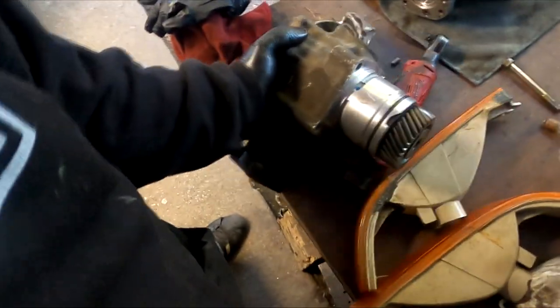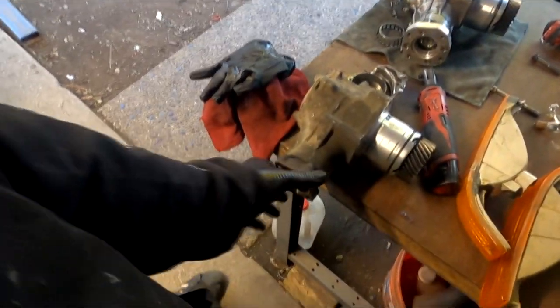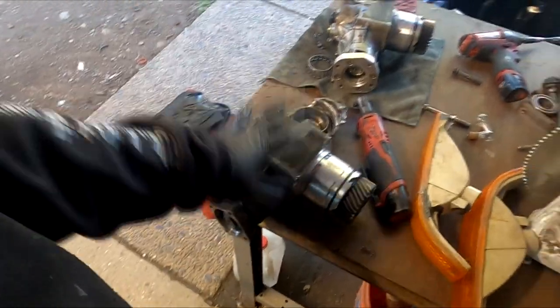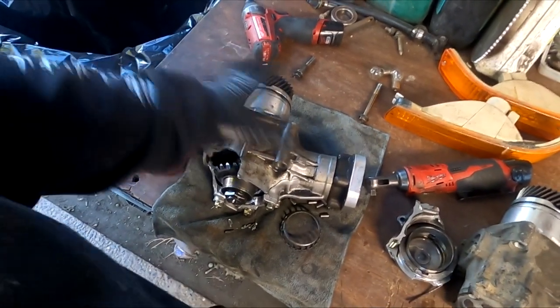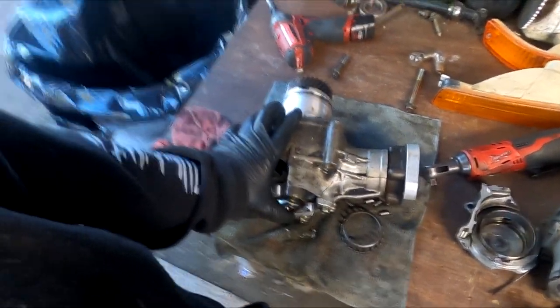The good thing is I have a spare transmission in storage and on my way back home I went and snagged it. I did have like three other transmissions but I sold them. So I'm going to transfer this transfer case over, clean the surface up, RTV it, reinstall it, and hopefully everything is good. If any of you guys have a B all-wheel drive five-speed transfer case for sale — specifically five-speed, because they are different from the automatic — let me know. I'm looking for a spare, so send me pictures so I can verify before buying.